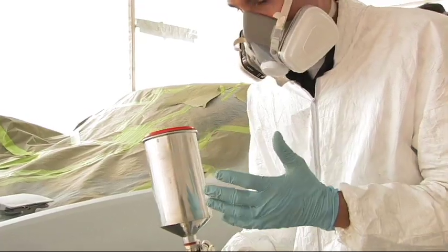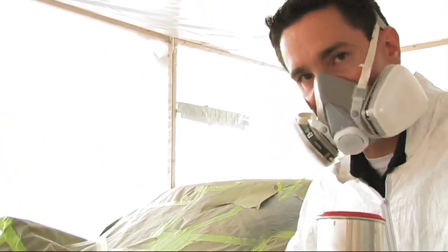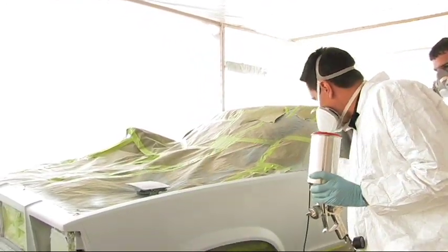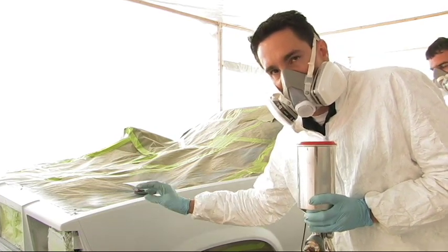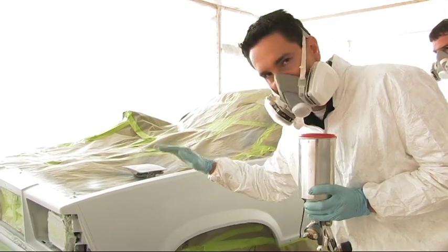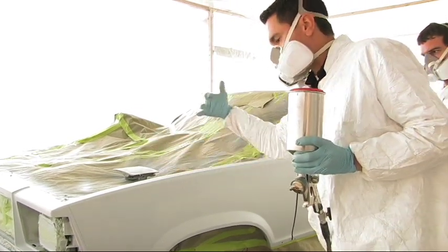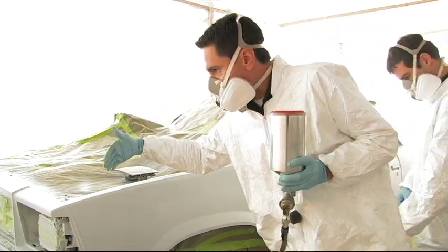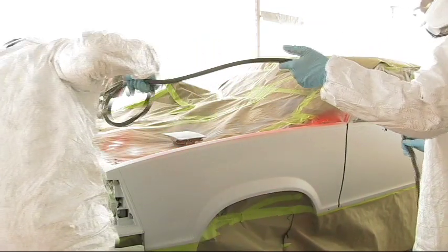I'm going to start laying down some paint, but a quick technique: when you spray, start from the top down. Say I'm spraying the fender — start from the top, work your way to the right, stop at the break of the panel and work your way back. You're going to want to overlap your color each time so you don't get stripes — slightly overlap for even coverage top to bottom. Also hit all your hard-to-reach areas first so you're not bending over the car and rubbing your suit against the paint. I'll hit the back side of the header panel and back side of the fender first, then work my way from the top down.